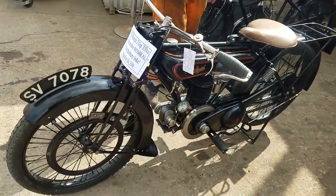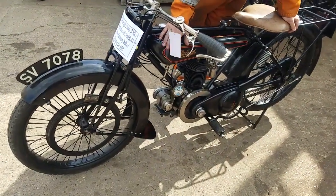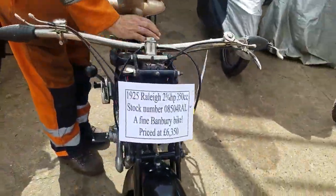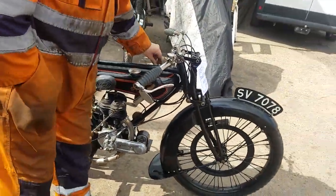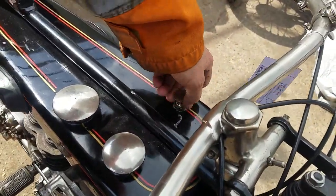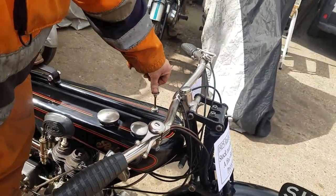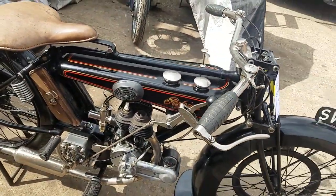You've been for a little toodle in there? I have been about 7 or 8 miles maybe now. That's good. Yeah, initial run of 6 miles and then a few little tweaks. Put a little leather washer in the oil pump because that was piddling out when you lifted the plunger up. You don't want an oily left knee, do you? No.